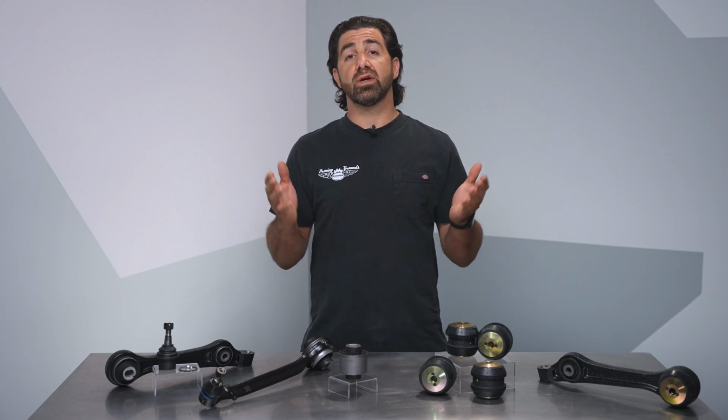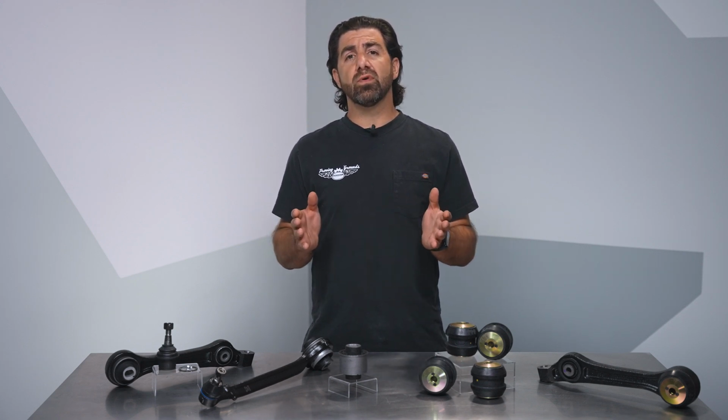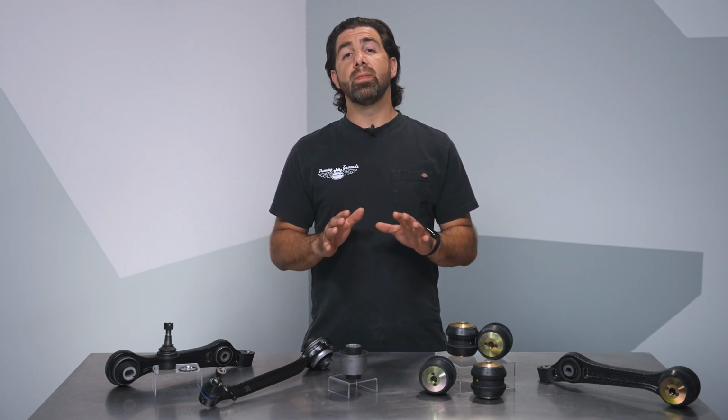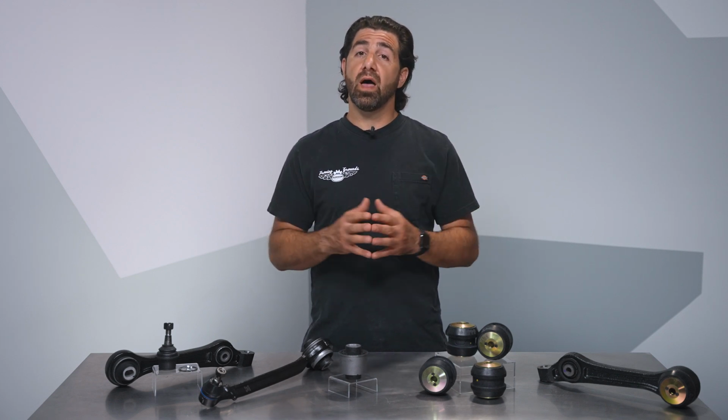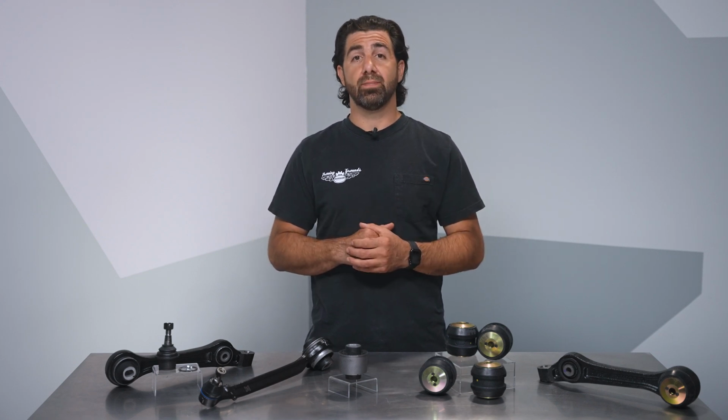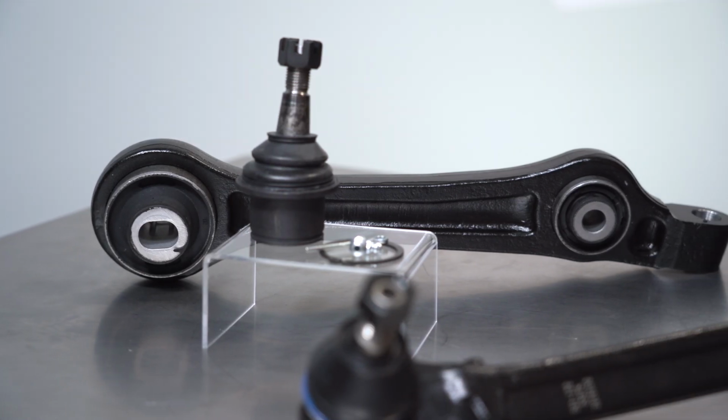Unlike the shared legs a traditional arm uses, these platforms have separate front and rear units, which is fairly common these days. Dorman makes a few solutions for cars that can't be aligned, exhibit excessive free play, or cause customer complaints of clunks or pops. The first and most obvious are full replacement arms.